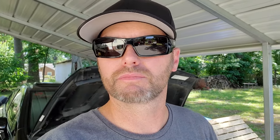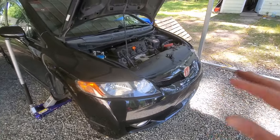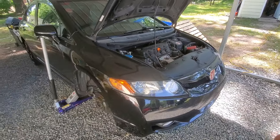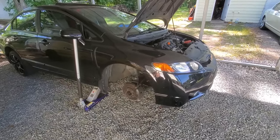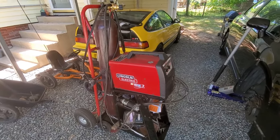There's not enough room to get any kind of tools like a drill or an easy out in there — and that's even if you could get the easy out to work, because I've never really had too much luck with an easy out. But since this is an aluminum block and it's a steel bolt, I have a solution: welding a nut onto the stud and turning it out of the block. Now just because we're working on a Honda today doesn't mean this technique only applies to Hondas. You can use this on pretty much anything that has an aluminum head or aluminum block. I have done this technique plenty of times on GM LS series V8 engines — those exhaust manifold bolts break off and they're tough to get out, but this technique works great.